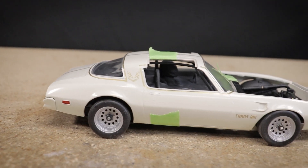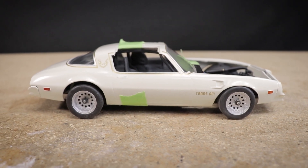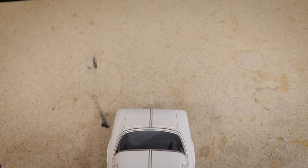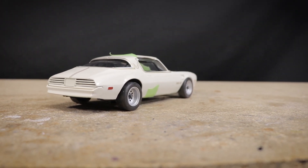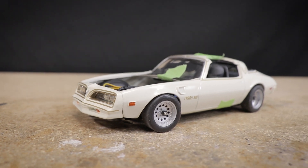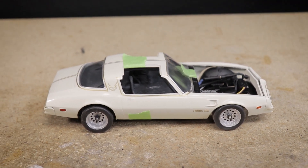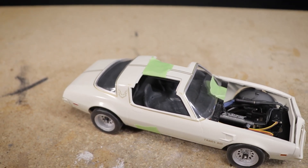As of now, I'm thinking the best solution will be to simply keep this same drivetrain and install a larger motor with more torque. Fortunately there's plenty of room under this hood for a larger motor, so that is a possibility. I think 3D printing a gear reduction set at this scale would be very difficult — maybe on a slower, lower-powered car it would be doable, but it would take time to design and prototype. If any of you know of a gearbox compatible with this motor that might fit this car, let me know.